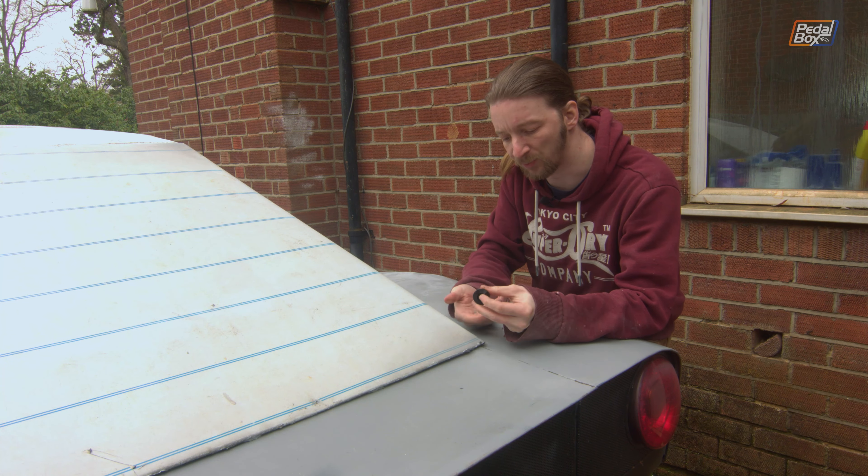After the abject failure that was our paint work today, we're going to try and go for an easy win. After last episode's success with the bonnet pins we're going to see if we can replicate that on the back here. We've got some slightly simpler and cheaper retainers — a nice little push button that releases the pin. That's a threaded bar, much like the one on the front, that we're going to thread down into something that will attach to the frame; press it, it pops out, and the engine bay can open. The process is going to be pretty similar to what we did on the front end — figure out where the hole needs to go to be symmetric and clear the body opening, punch the hole through, then do precise alignment for the thread bar as a second step.